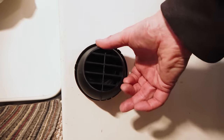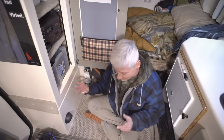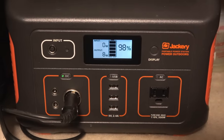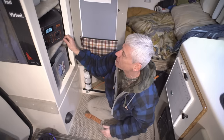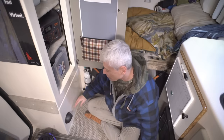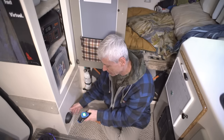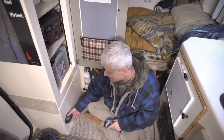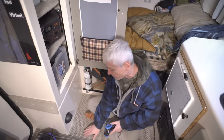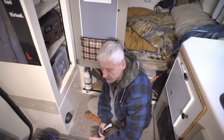One new addition was a proper vent — not only could it take the heat, but it rotated to direct hot airflow. It didn't take long to heat and was actually a lot more efficient this time. It only went down to 98% on the battery, cycling between 5 watts and 11 watts. The vent is hot — 183 degrees Fahrenheit, which is 84 Celsius — but it's not affecting the fiberglass around it. I have it on a slight angle, warming this area as well as the rest of the trailer.